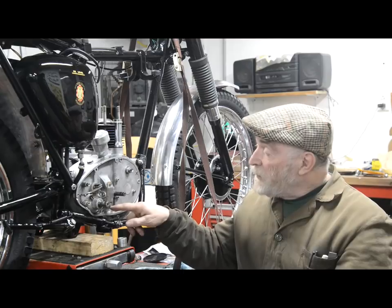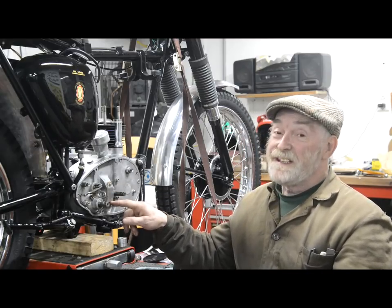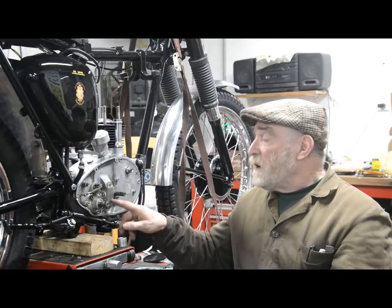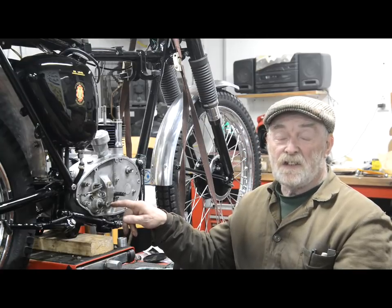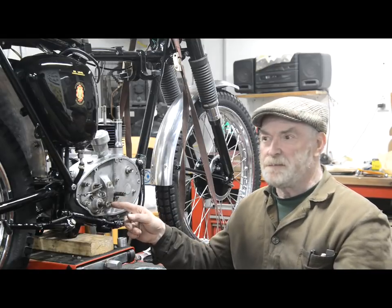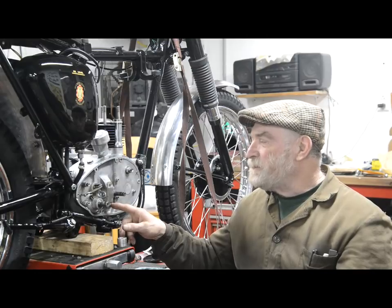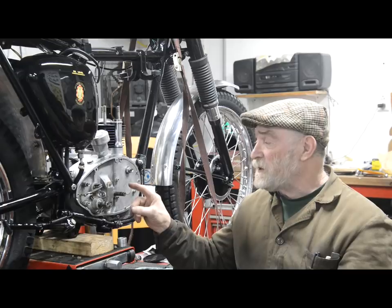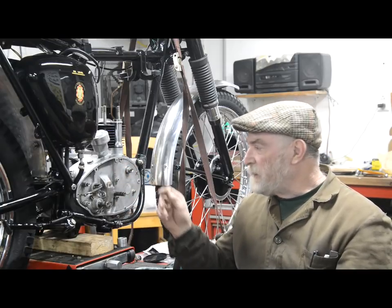I had a comment about the repair job here. There were a bunch of ways I could have done it. I could have helicoiled it, all sorts of things. One chap mentioned I'd just tap it out to the next larger size on the unified thing, so it would have been, I don't know, 12, 24, whatever. Well, I didn't want to do that because I know when I'm working on jobs, there's nothing worse than to find you've got to put something on that has two bolts and they're two different bolts. So I wanted to keep that the same.